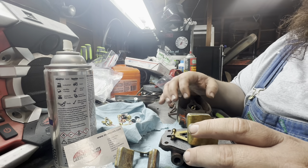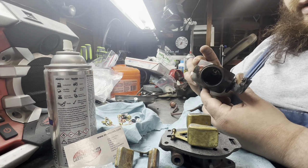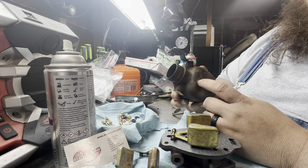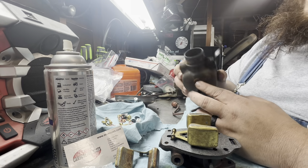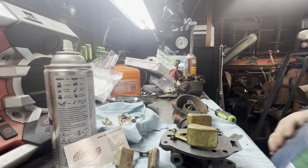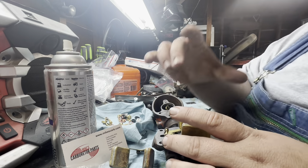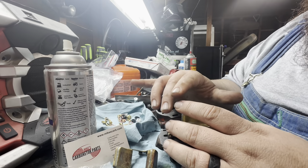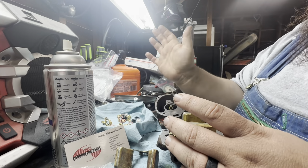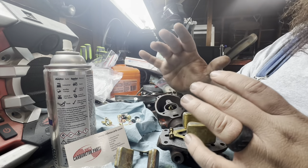And it'll start pouring out, usually out of this hole down here. There's always a hole in the bottom of it. I got like a grating in there, so not too much dirt gets sucked up into there. But fuel can pour out on the carburetor, is what I'm trying to say in so many eloquent words. But on a downdraft carburetor, the advantage on these is your fuel tank's usually higher than the carburetor, so the fuel will always run into it and pour out. But these are updraft.